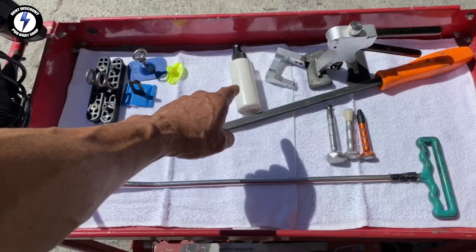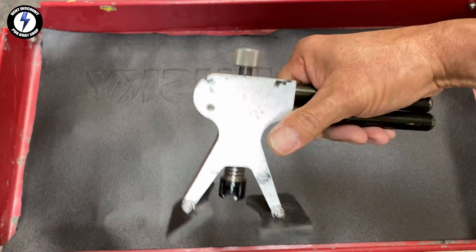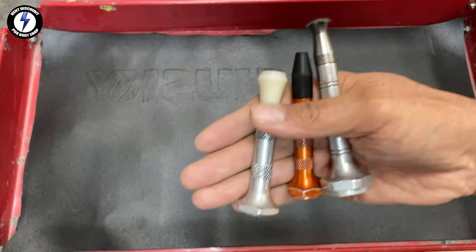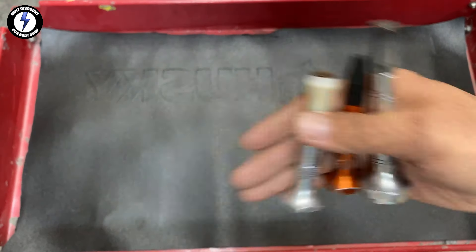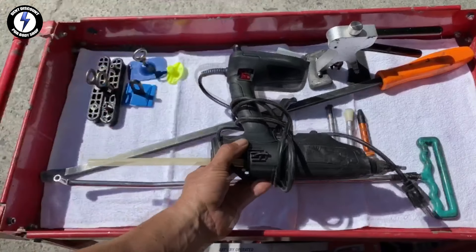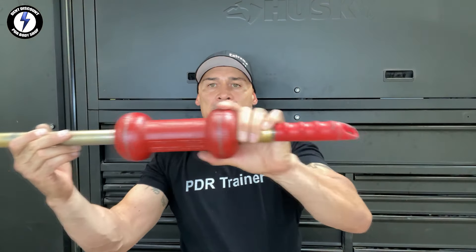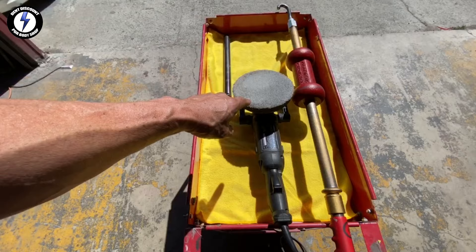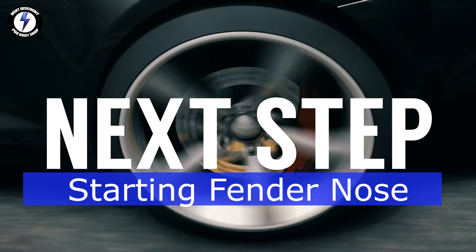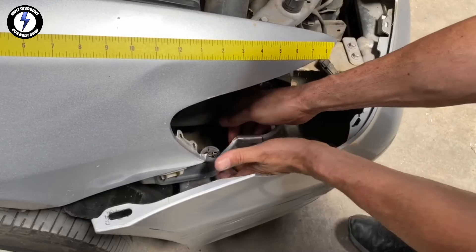I also have alcohol spray for cleaning, a PDR edge tool, and a mini lifter for lifting the tabs. Three knockdowns for the crowns, PDR rods including a 24-inch double bend, and a simple large screwdriver for pushing out the dents. A hot glue gun, a pipe and a slide hammer for body repair work, and a buffer for polishing. Lastly, my PDR light for seeing the entire damage on the fender. Let's begin this how-to tutorial.